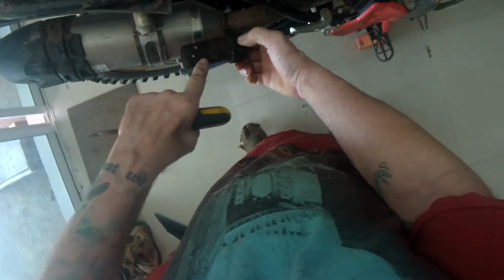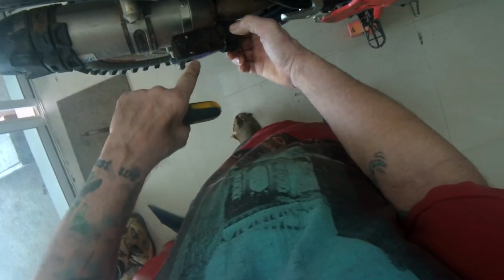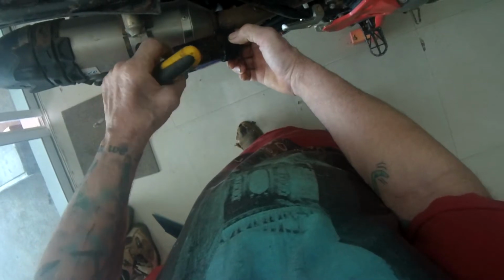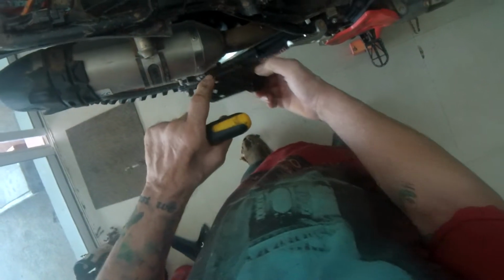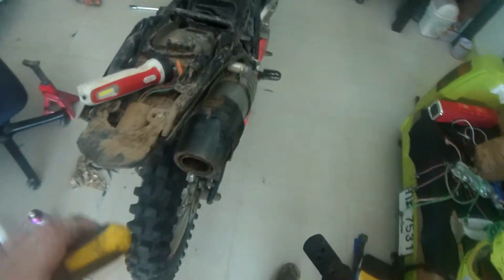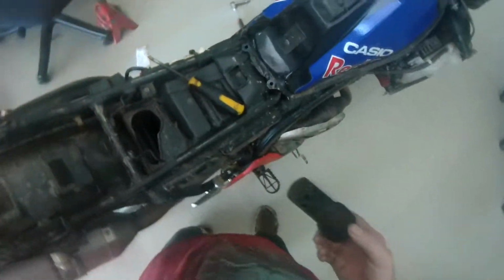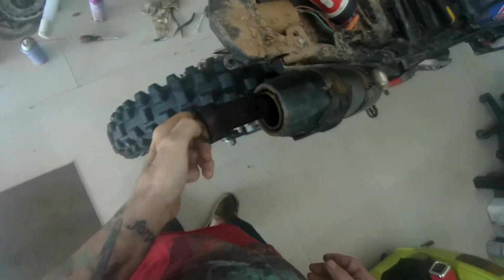Now you could regulate this actually by putting these holes further up here and leaving that space filled in there, because then your primary waves are going to bounce against there, and they're going to have to come back here to find their way through. They'll then bounce off the sides of the sound deadening, and they'll still come spilling out the back full pelt, and they'll still be loud. So that is a start, but it's not enough for the sound testers in Pai.